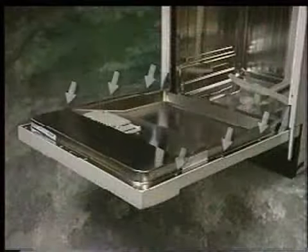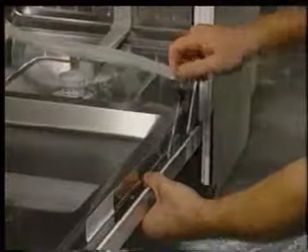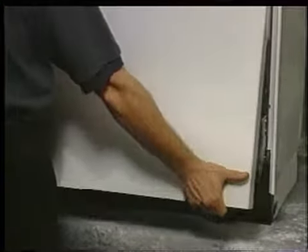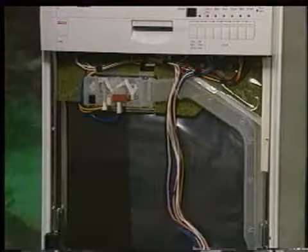To remove the outer door, you must first remove the six screws located on the inner door. Remember to support the door panel as you remove the screws. Now, with the screws removed and the door in the closed position, bring the bottom of the outer door panel out toward you, then slide the top down and out from under the control panel. As the outer door panel is being removed, the left or right door guards may shift or fall out of place. To reposition them, simply slide them back in over the hinge.